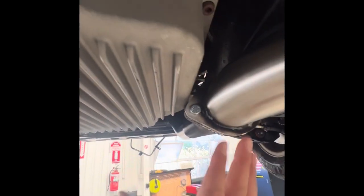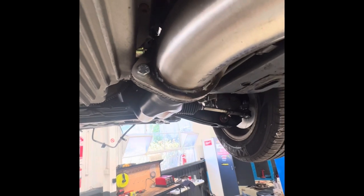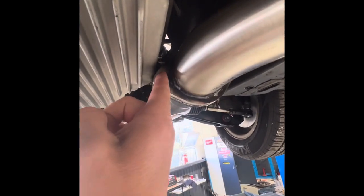One small issue that I'm not too happy about. The flange you can see there is pretty much an eighth of a mil away from the 400. So when that starts shaking, honestly, that's going to annoy the hell out of me. So what I'm going to do is just drop the exhaust off here and just cut a notch into that flange there. And that shouldn't inhibit anything. It shouldn't really affect too much. If I take sort of a 5 mil notch on the outside of there, it should go back together pretty nicely. Everything's all done in here.